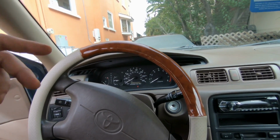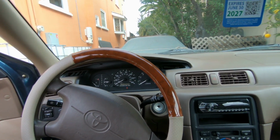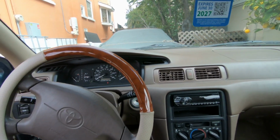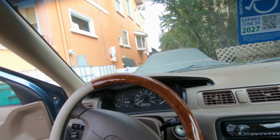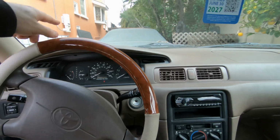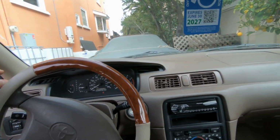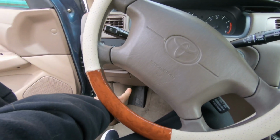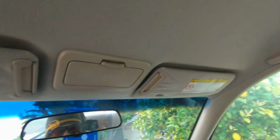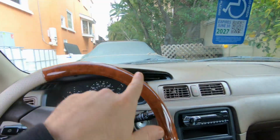Because I'm definitely attributing it to the water leaking into the car, then frying an electrical component. It doesn't have to be the one that I pointed out. It could be one up front, because the leaks I was seeing, they have bad leaks in the front. So bad that they want you to take off the fenders and patch them, and so bad that they want you to patch it from the inside. And then all on the top, those rails on the outside, they want you to patch, and the back seams down the back, they want you to patch.